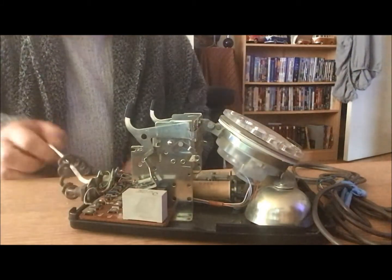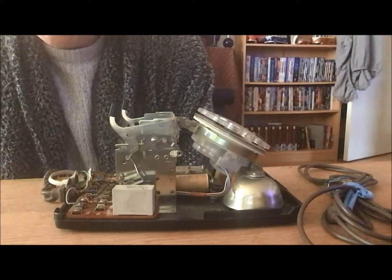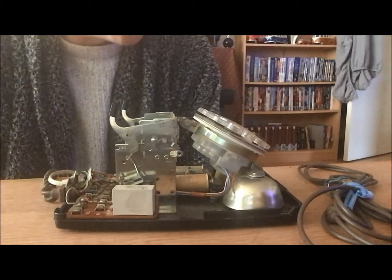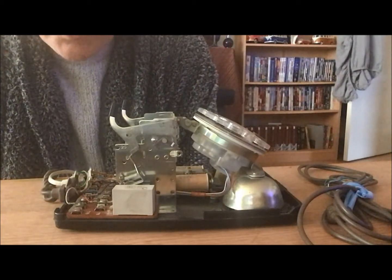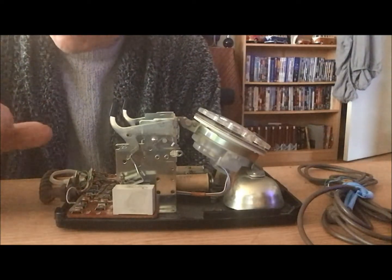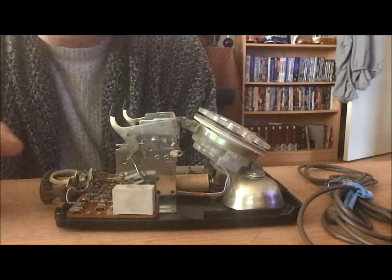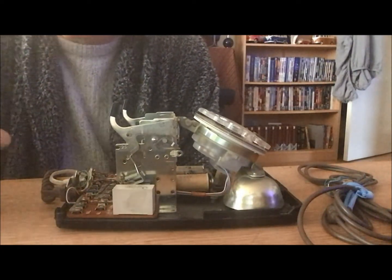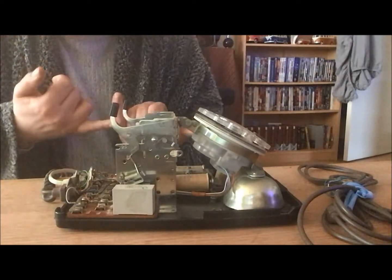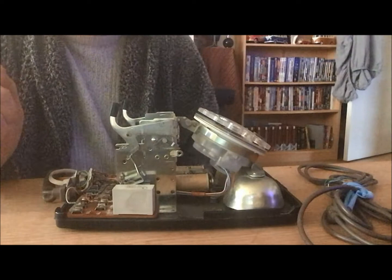We have now connected a new BT plug-in type modern lead into an old rotary dial phone. This is the 746, and this system will also work on the 706 and the 706L - the L just means it has letters as well as numbers. If you're doing the wall phones, which are the 711 and the 741, be careful to get leads without grommets, because the grommet would get in the way when feeding the wire through the back of the phone. Order them specifically for that phone - it's just the same wire without the grommet.